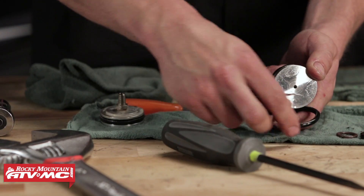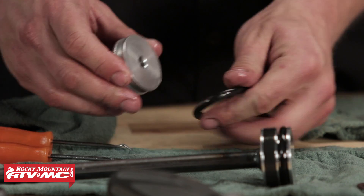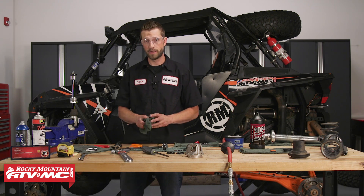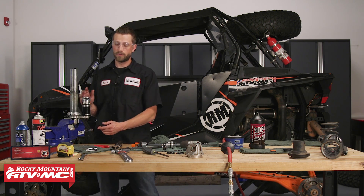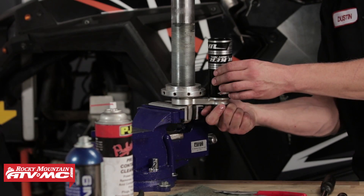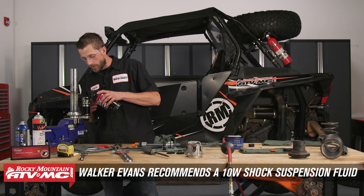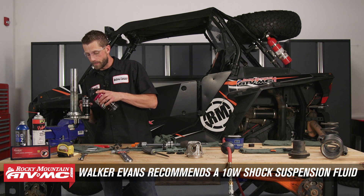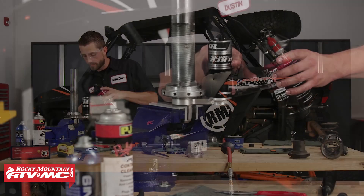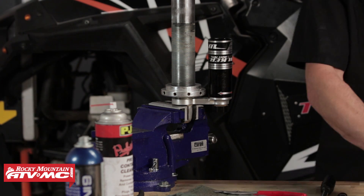Now we need to replace the o-rings on our IFP and our reservoir's seal. Now that the o-rings are replaced, we can pull the shock shaft out of the vise, take the shock body, get it mounted, and finish the assembly. Before adding fluid, take the compression adjuster and back it out to full soft — count the clicks and write them down. Take the shock fluid and add a little bit to each side so it's equalized, with the fluid sitting about halfway or just a little more. Once the oil height is equalized, it's going to stay in that position, then we can take our IFP.